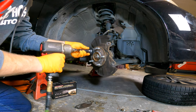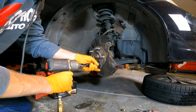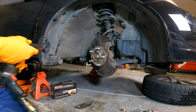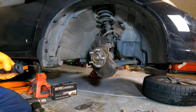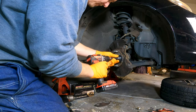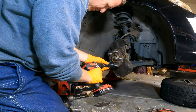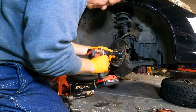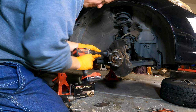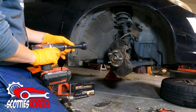I purchased a really cool hub cleaning kit off of Amazon — around 50 to 70 dollars. It came with a bunch of different pads and a few different bits. I found it works best in a drill, not an impact gun. The kit and pads slide over the lug nut studs so you can clean up the hub surface around them easily. It took me maybe a minute or two to clean up the hub — manually it would take 15 to 20 minutes. There will be a link in the description below for this hub cleaning kit.